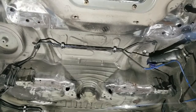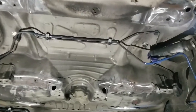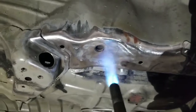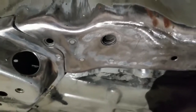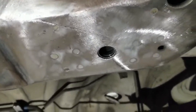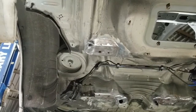Basically what you need to do is prep the floor — check it for cracks first. One way to do that: take a propane torch, heat the area up, and it will usually show the crack as it expands. So we have the floor right here, there's a tiny little line in it. As we take the propane torch and heat it up, the line gets a little bit darker — and there's your little crack. We'll stitch this, then grind it flush and put our plate on. Other than that, this car has no cracks on either side in the back — pretty clean.